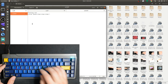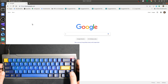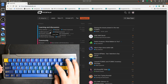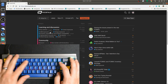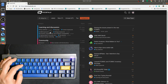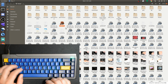However, if I tap the Alt key, it actually behaves as the one-shot layer activation. So it turns on my function layer until I hit the next key. For example, if I want to refresh a page, normally I would have to hold down function with my left hand and then hit 5 to get F5. With this setting, I can just tap Alt and hit 5 and it'll do the same thing. Another example — if I want to rename a file, I tap and then hit 2. Pretty cool.